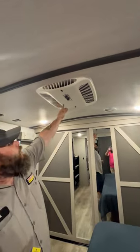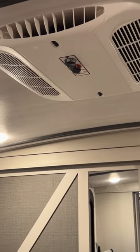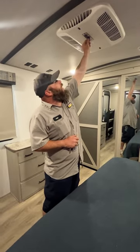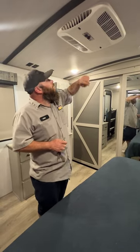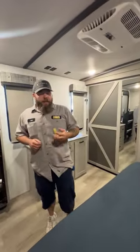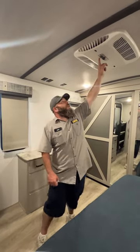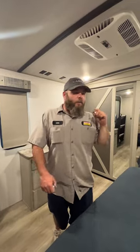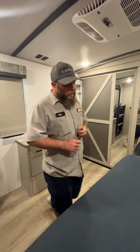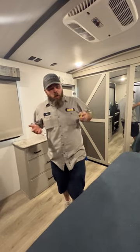This one is a manual style air conditioner, so basically you would have to turn the knobs. Right now we are in high cool and we have this guy basically turned all the way down, so it's just pumping out that cold air continuously. You can adjust this guy right here where it would shut on and off. It also has a little redness on there — the reason why is because this actually has an aftermarket piece that can be installed for a heat strip. That first low fan setting would actually be low heat if that accessory item is put on this air conditioner. What that does is it just pulls in that cooler air and warms it up for you. That only works until about 39 degrees — after that, it does struggle to warm that colder air up for you.